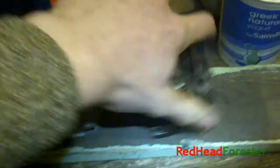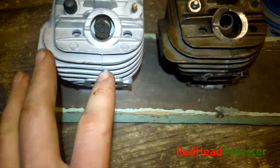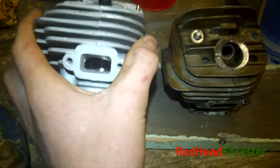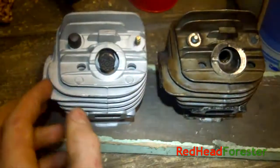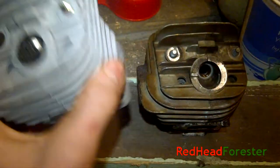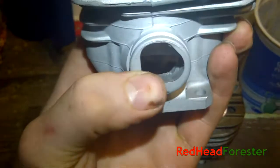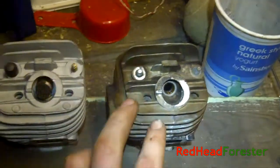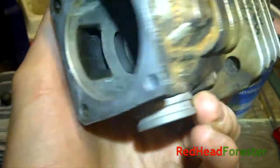So my thoughts on these, having just bought the Highway and not used it at all yet: overall, you get what you pay for. The coating on the inside looks good at a glance, but overall build quality I'm not quite so impressed. The bits that really matter are alright, but I'm going to go over this with a Dremel, widen up the ports a little bit — maybe just slightly wider than on the stock OEM cylinder. It just needs a bit of cleaning up really.